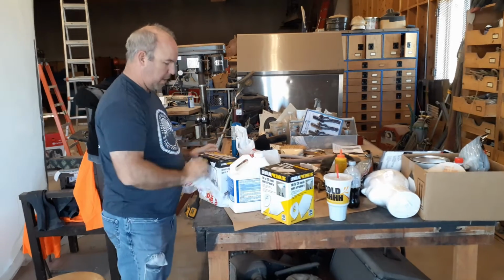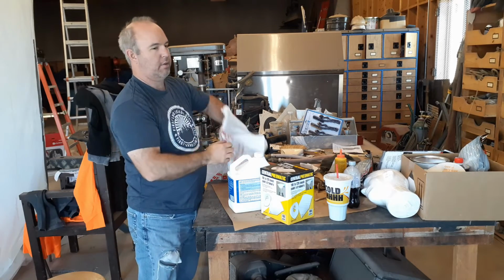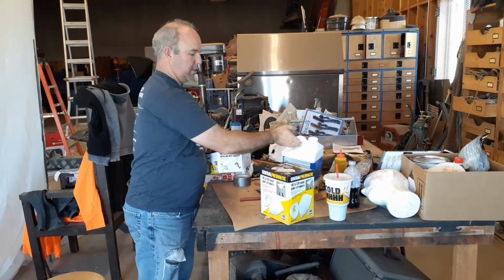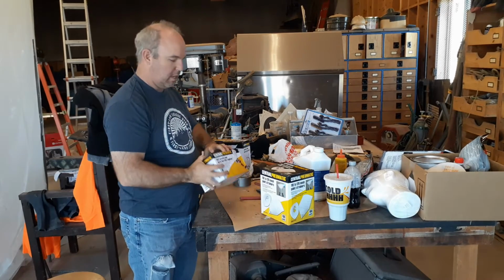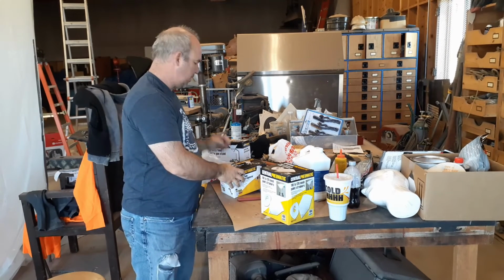Yeah, it's a cheaper one, but talking to the guy who prepped my paint, how he likes to paint is to set the PSI on the air compressor down to 30, and then have the gun regulated between 16 to 18 PSI. I got this gun that has the regulator right on it, so it just saves a lot of headache.